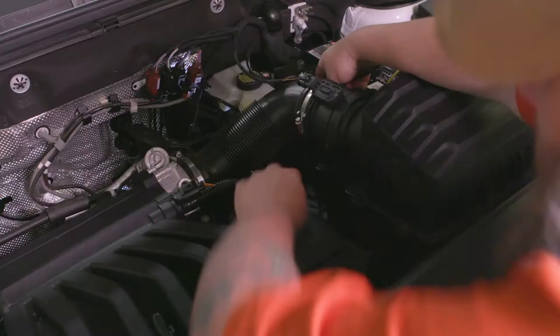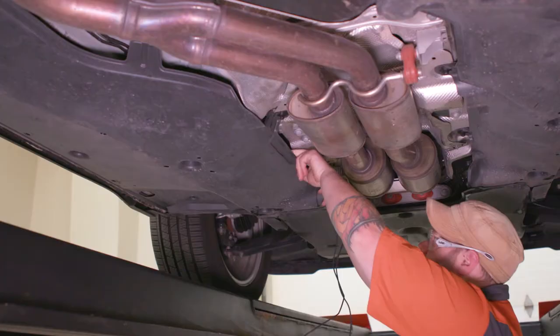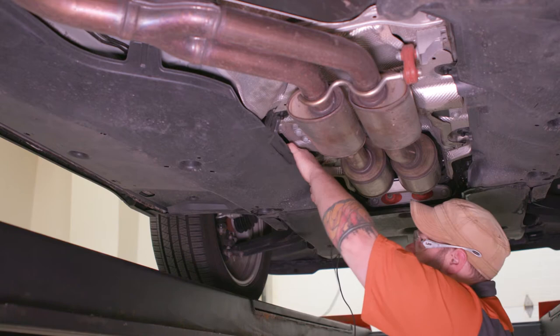Route the long black power wire down through the engine bay to the bottom of the vehicle, being careful to stay away from extreme heat sources and moving parts. Once you have routed the black power wire to the undercarriage, continue to route the wire above fascia panels and above heat shields. This will protect the power wire from road debris. Use the included cable ties to fasten the wires as you route.